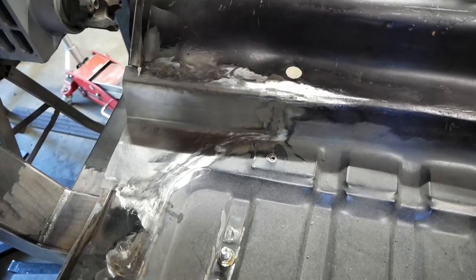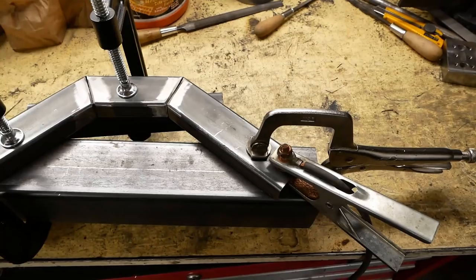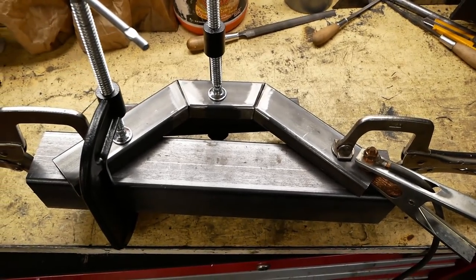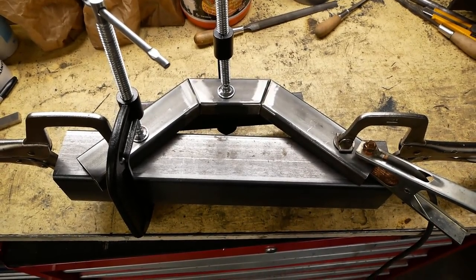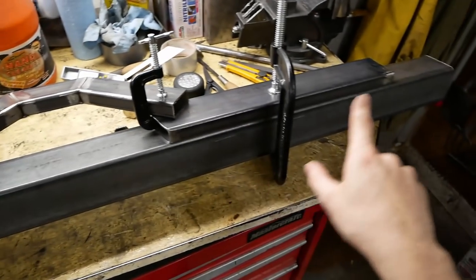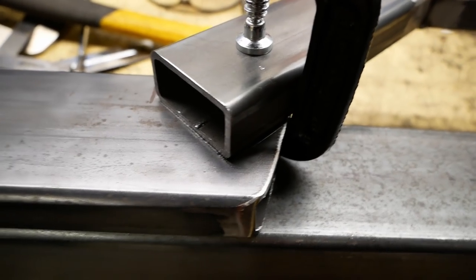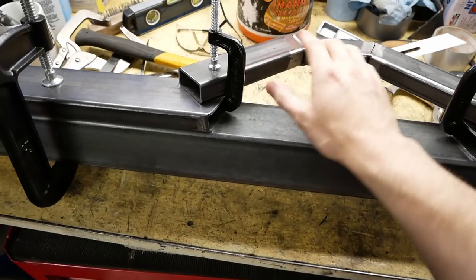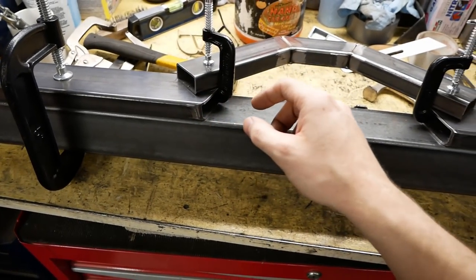However, I suppose it still looks better than a lap joint would have. Whilst our doppelgangers get on with the other side, let's turn our attention to building the new box section, as without it, the floor will literally flop around like an old wet floppy fish. Instead of the previous sheet metal 2x2 box, we elected to use some 1/8-inch wall 1x2 and 1x3.